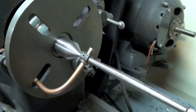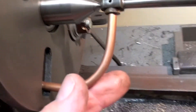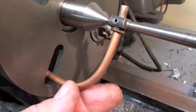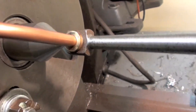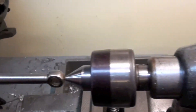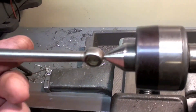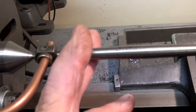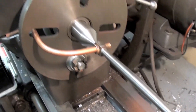The rod is over here in the lathe. I set it up between centers and I've got the face plate on here. For a drive dog, I just used a piece of quarter-inch copper tubing — it fits right through the crank pin bore there and gives me plenty of room. There's really no way to chuck on it, so I had to put it between centers and just ran some emery on it to clean it up a little bit. It was just pitted real bad with rust and just didn't look good.